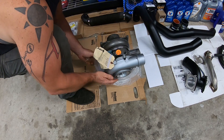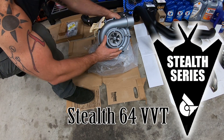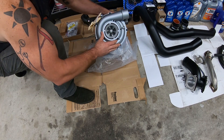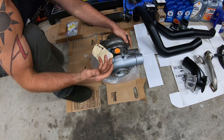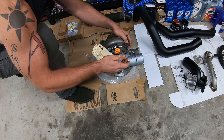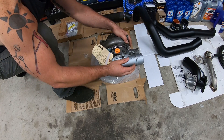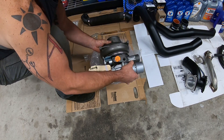No mods required or anything. This is built on a modified stock core - they actually take the stock frame and modify it for their needs. Put in a custom turbine. Stock turbine is good up to 530 horse; this increases that by 120, so you're good up to 650 horse. Significantly lower EGTs, quicker spool up, just overall better. Badass. And not to mention just sexy as hell.